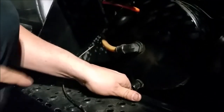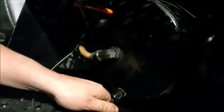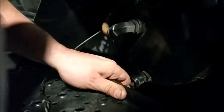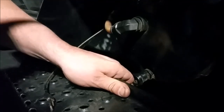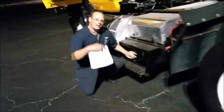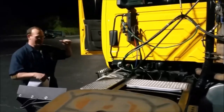The reason why this tank may take as long as the second tank — even though it's segmented — is because of a check valve in there. It's a one-way check valve to not let air go back into the supply tank from the secondary tank. So there may not be any air that comes out on our supply side, which is the other side of this tank. That sounds like it's empty — so we're on the inside, that's the secondary tank. Then we're going to go underneath the truck and do the supply and the primary.